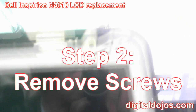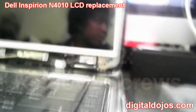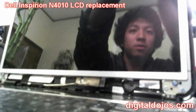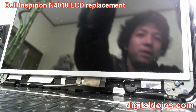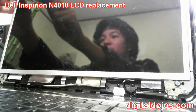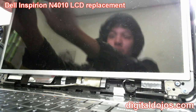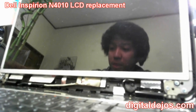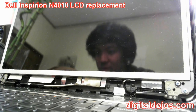Remove the top right and top left screws while keeping the bottom screws in place — just loosen the bottom right and bottom left screws rather than fully removing them. This is because there are screws on the side of the LCD, and we want to tilt the screen forward to access those screws. The silver screws in the top left and right should be the only ones there. For the bottom, identify the two holding the actual frame of the screen and just loosen them.